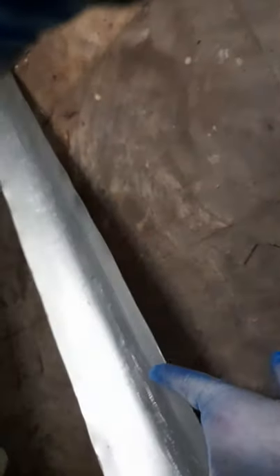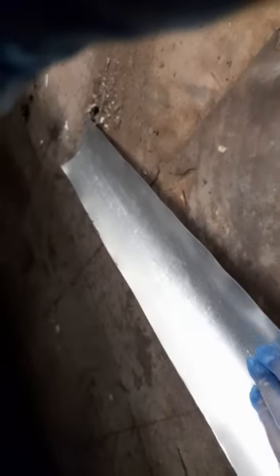I've test fitted this panel here. The unique selling point of my build is how heavily I'm going to corrosion protect it - it's all been seam sealed up. Once you weld it, it'll be tacked along here and along the top edge. How do I then get on the back side of this galvanized steel to wire brush the welds and cover them with seam sealer? Well, you see what I did here - I opened the two sections up so I could get a paintbrush in the back. That's POR-15 up there, seam sealer inside these gaps.